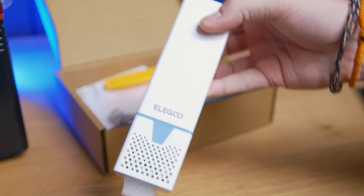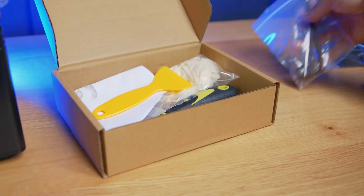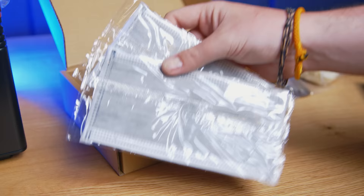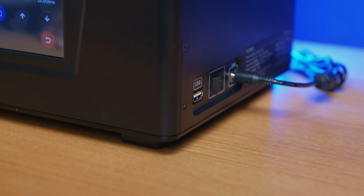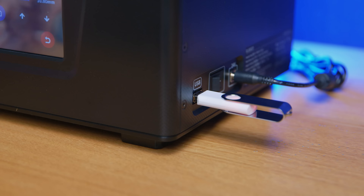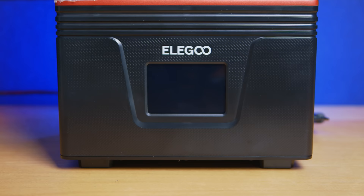You can get replacement carbon blocks, or as some people have suggested, just use carbon filters from fish tanks stuffed into the enclosure. It comes with your typical box of accessories: masks, gloves, a funnel, scrapers, and instruction cards. You also get a cheap USB drive — I always recommend replacing it with a decent one, as cheap ones can cause the printer to lock up. One thing that bothers me is the USB port, power button, and power socket are all on the side at the front, which means you can't place anything right up next to the printer, though this is done to keep costs down.